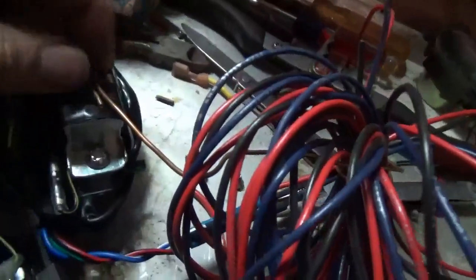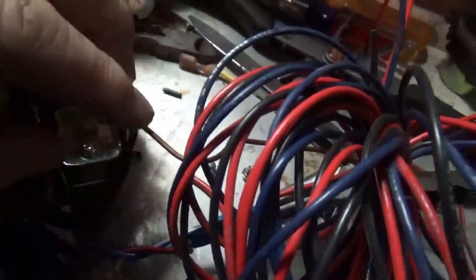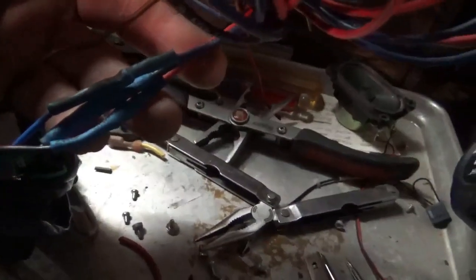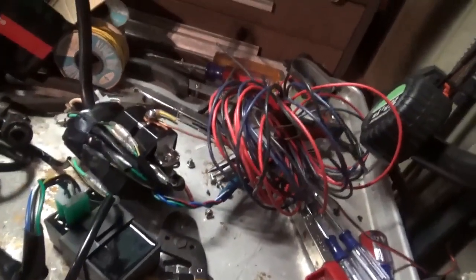If you do all that and compact it down and extend the wires, this is what you end up with. You can see I just taped the CDI right to the spark coil. The wire coming off — that bolt there on the frame — I put a copper wire to attach to the ATV frame. I extended all the wires: the black and red I made red, the blue I made blue, and what is eventually yellow I made black, which is also ground. Not hard to do.